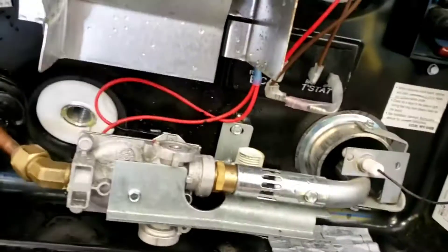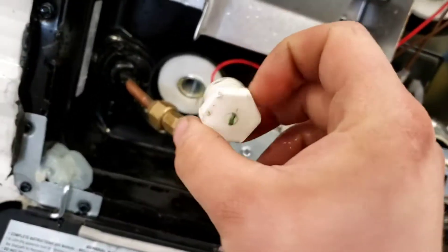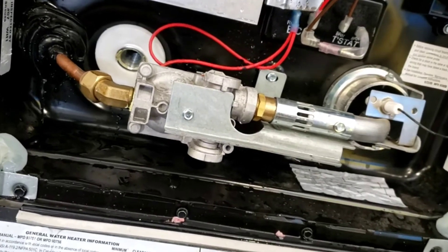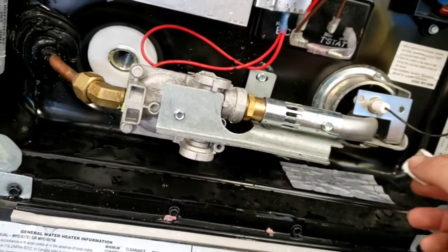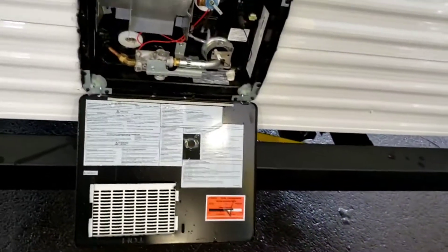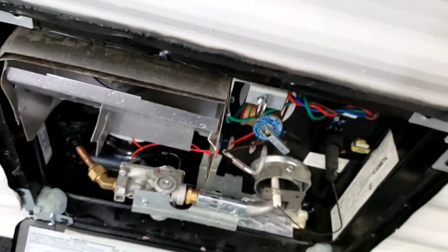Water heater — super simple. Only thing you'll have to do when you get this is put your plug in the drain hole. Get it threaded by hand, then 15 sixteenths is your socket size — snug it down with that. They also make a special tool for it you can buy. Don't over-tighten it; it is a plastic thread. Once the plug is in, it will fill up automatically whether you do it from your pump or from your city water. Turn the water on, let it fill, and once it's filled you'll be able to turn it on.